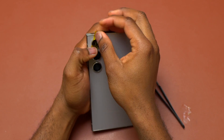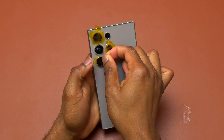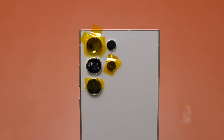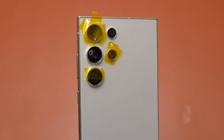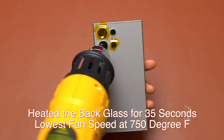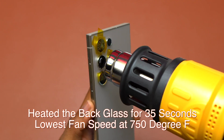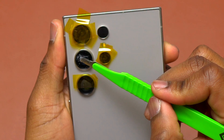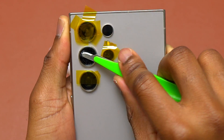If you're going to use a heat source, you need to protect the cameras before you do that. I'm using heat-resistant tape to cover all the cameras — both broken and not broken — in order to use heat to help me remove the second broken camera glass. Now I'm going to insert my green scalpel, the tip of the blade, between the broken camera glass and the camera bezel, and start pulling.